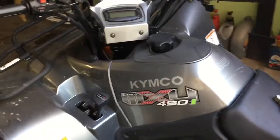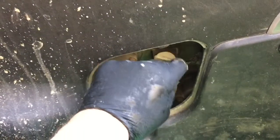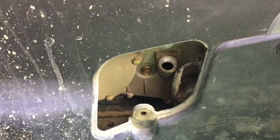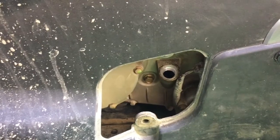The first thing you need to do is heat up your ATV. I'm doing this for about five minutes so the engine is quite warm. Then the second point is to unscrew your filler cap - that's where you take out the old oil, it will all be gone.